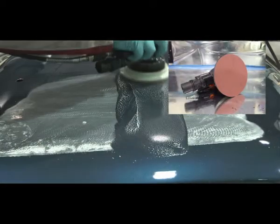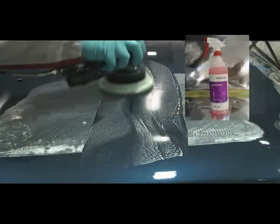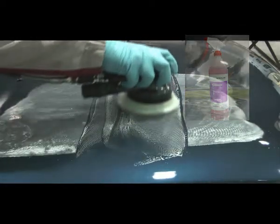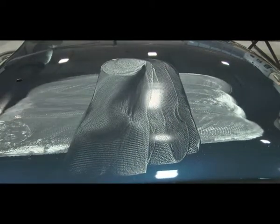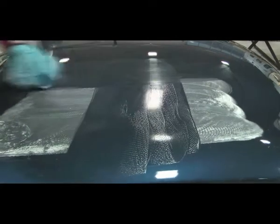Using the quality DA sander, attach a 3000 grade blend and finish disc and apply Bodyline Body Shine to the disc. The sander being used is a DA sander with a 125mm or 5-inch backing pad and disc. For this demonstration, we have sanded through the middle to show the difference the 3000 finishing disc makes. The area is wiped clean with a quality cloth and you can see the shine in the sanded area from the very fine scratches to polish out.